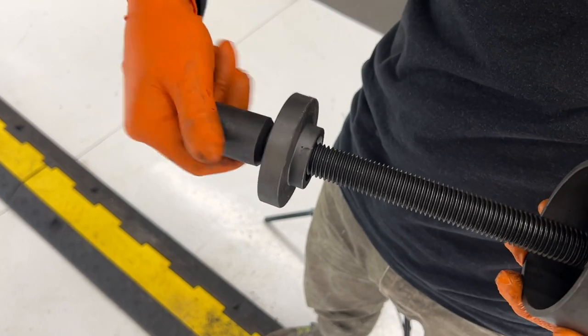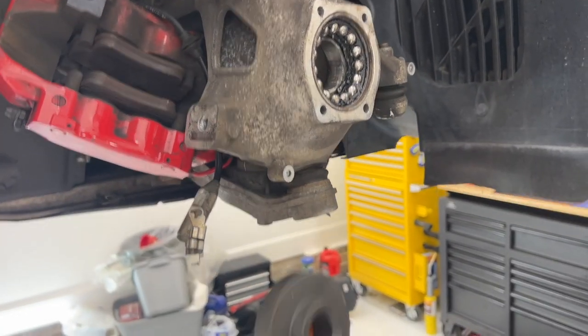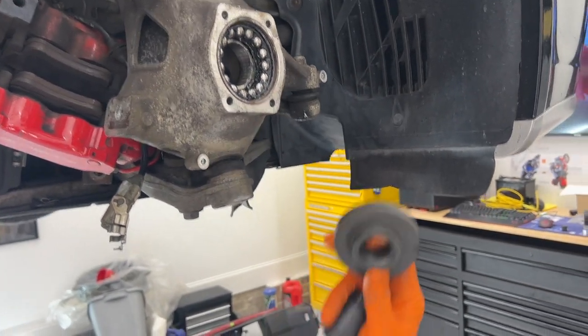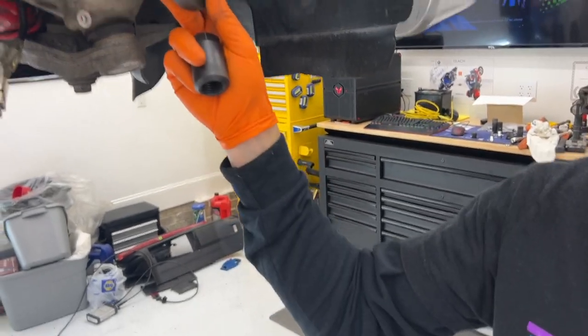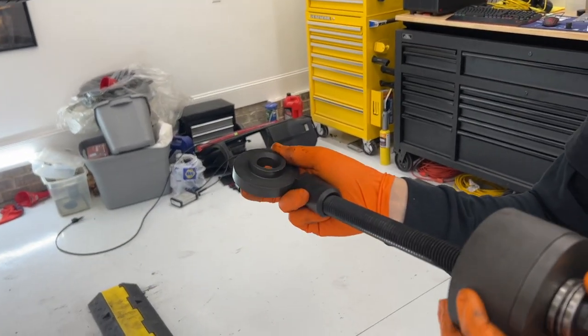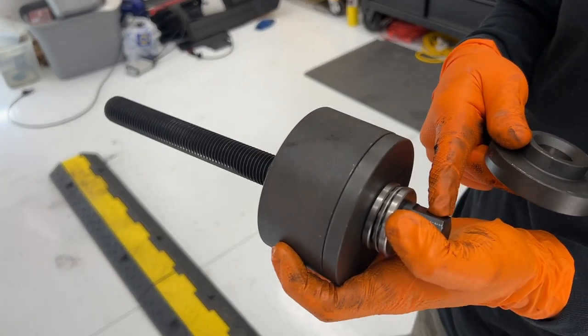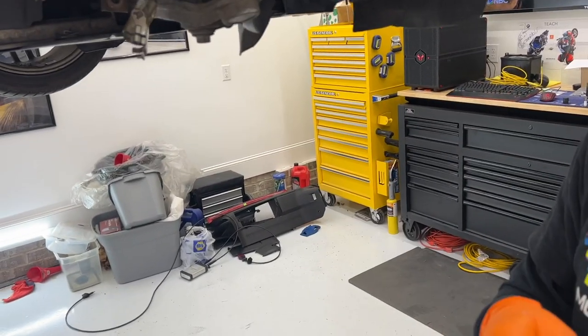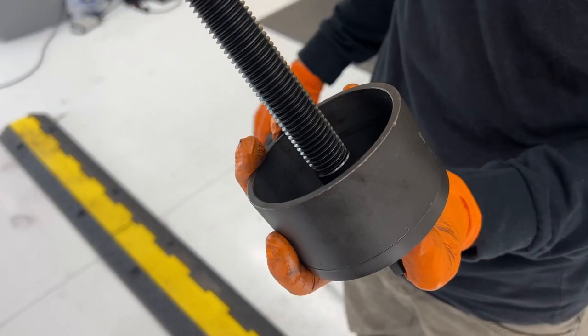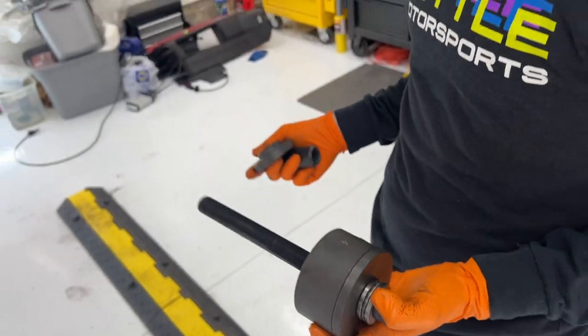So what we do now is you find the correct backside of the bearing. You want something that's just big enough to go through the bore of this upright, but it's not gonna make contact with it, so when you're pulling the entire bearing through. Right, yep. So we stick this back there, we run this with a bearing washer through, a captive nut on the backside, you tighten them, and then you can spin this. As it tightens, you're holding the back nut, turning this, and it's drawing the bearing into this cup here. Yes. Pull the bearing in. Pulls it straight in.